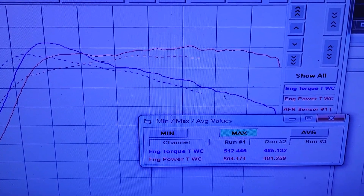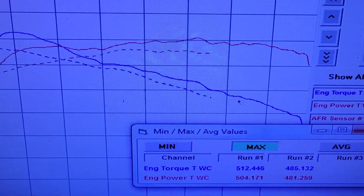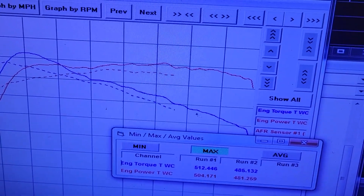Here's the differences in the graph — the dotted line is where we started, the solid line is where we finished. The graph doesn't look very smooth up there. This thing actually had a little bit of a fuel pressure problem — it was four and a half PSI at idle, supposed to be six and a half to seven on the Holley typically, and it was three and a half at WOT. It looks like in the graph that it wants more ignition timing, but I put 34 degrees in and actually lost 10 horsepower, so bumped it back to 32 where it was happy.